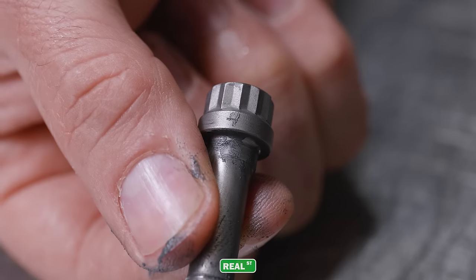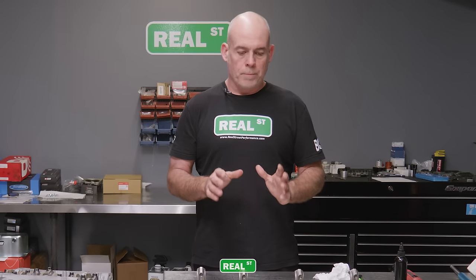You do, however, always remember that you're gonna keep all of the caps with their partner rod. I've labeled all the bolts too, that way if I take this engine apart in the future, I'll put all the rod bolts back in the same hole they came out of. But the direction of the connecting rod itself doesn't bear a lot of weight, so don't get too caught up in that. Just be uniform in your work.